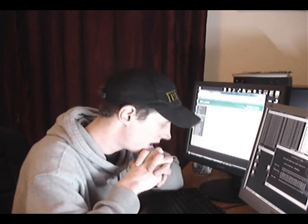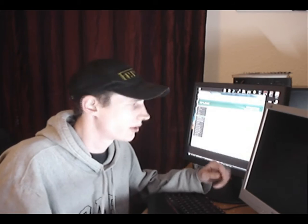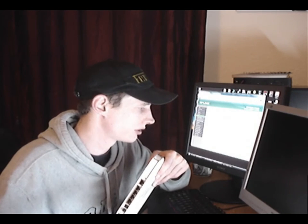This can be done with wireless cards but we're going to do it with a spare router. This PC connects wirelessly to my router and that goes out onto the internet. To set up this router we're going to need to disconnect from that network because we'll have conflicting IPs — the standard IP for this router is 192.168.1.1, which is the same as my other router, so we need to change the IP before we can use it on the network.